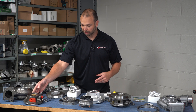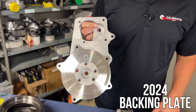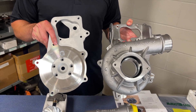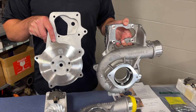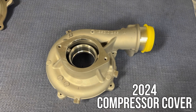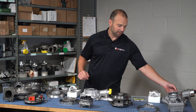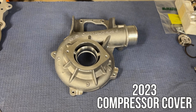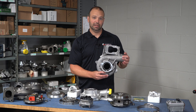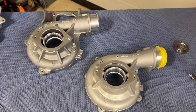On 2024, we go to a backing plate — the 23 did not have a backing plate. The actuator mechanism is now mounted to the backing plate. I think this is an easier part to produce than the old compressor cover, which had the actuator mount bolted to it. The old piece is a really bulky, awkward piece to handle; the new one is not. I'm guessing that the bean counters might have got involved and said, you know, we've got a lot of casting flow paths and extra work in the casting there — maybe go back to a traditional style on that.